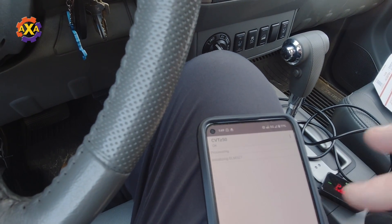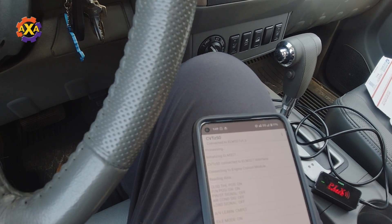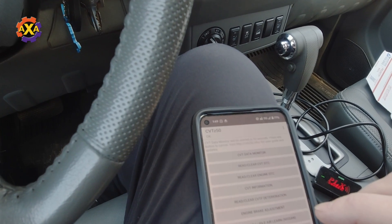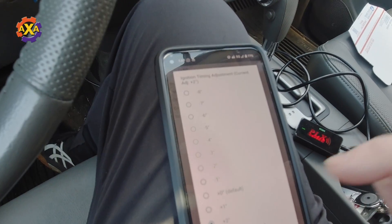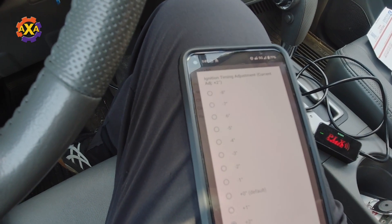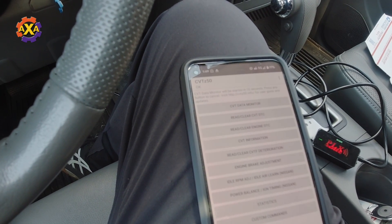Let's go back in here one more time. If you long press this option, you get into the timing. Right now you can see that my timing is 2 degrees — I went from 0, and you can go backwards from 0 up to 2, and just hit OK. The first couple of attempts when I did the timing change it didn't take, so you may have to try multiple times.